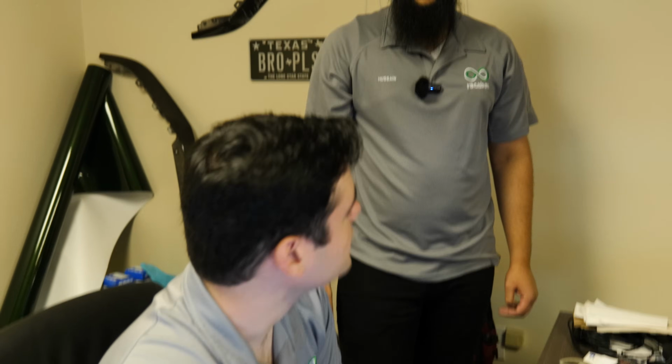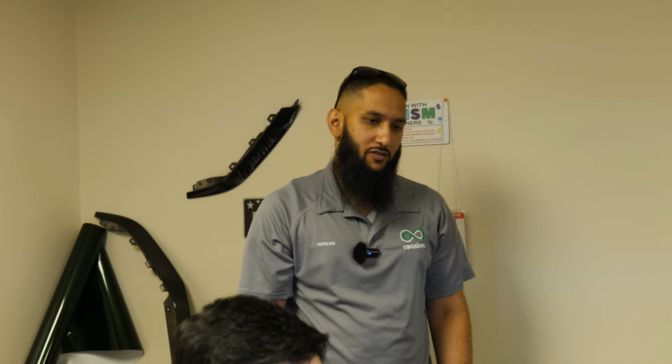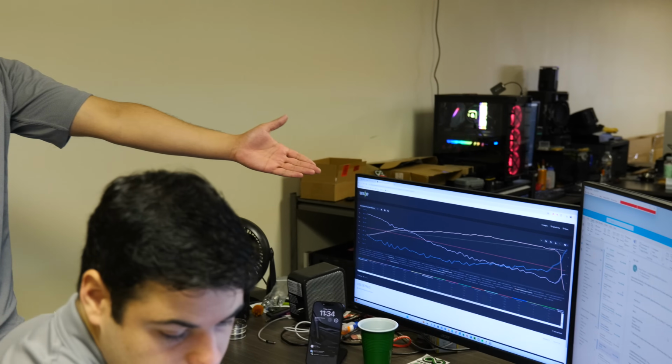At least a big bore, and these are what, 1800cc injectors? I think there's the Spool 2050s. Okay. So you could, but I think even the AMS Stage 2s might struggle with it, but the Stage 3s would definitely run full E. And then you've got the Spool 2050s and the XDI 2100s. These are Spool, right? Yeah, I believe so. Great success. Dual pumps, do it.